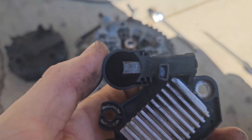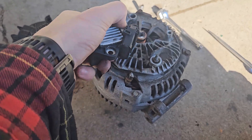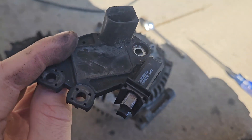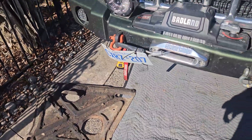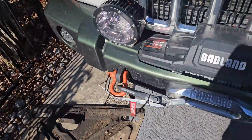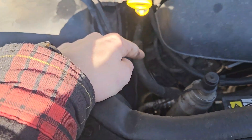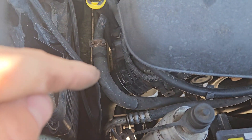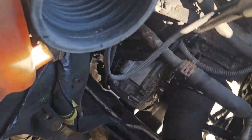Here's the voltage regulator taken off. It's got two contacts with a cover on them — you can slide this cover off to inspect them, and when you install it on the new alternator you'll slide that cover off so you can push the contacts in. In order to get access to this alternator I took the skid plate off from the bottom of the car and then I removed the air box. With the air box removed we can now see the alternator.